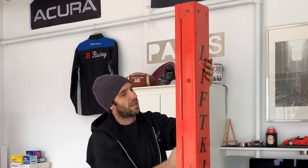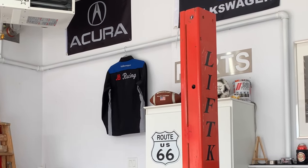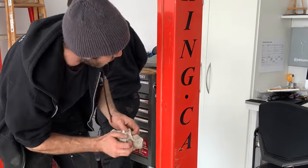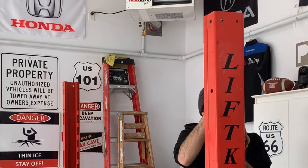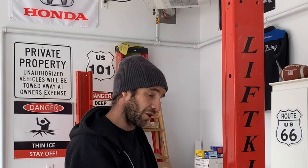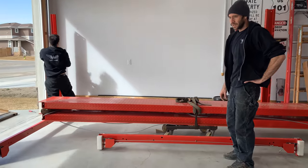I asked for good tips on upkeep. The most important rule of owning a hoist: always use your locks and never leave a car suspended on your cables. That car should always be resting on the locks. Other than that, keep everything lubricated. When operating the lift, it requires your undivided attention — one of the most common issues is working the lift while talking to somebody and not paying attention to what you're doing.